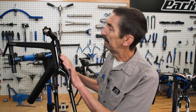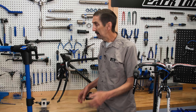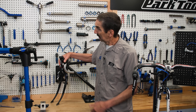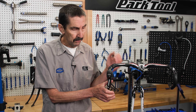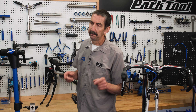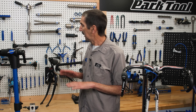But let's say we're building up a bike. You've got parts laying around, you want to use them, and you love the drop bar and those drop-bar levers. Drop-bar levers are traditionally short-pull. The side-pull and dual-pivots are short-pull calipers for a short-pull lever. But what if we mix and match? Is it going to work? Maybe yes, maybe no, maybe kind of. Let's see what happens when we swap things around.